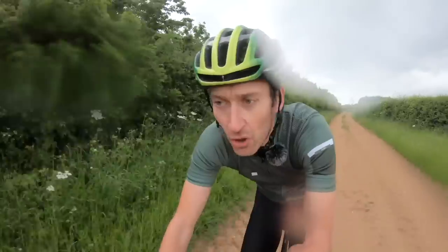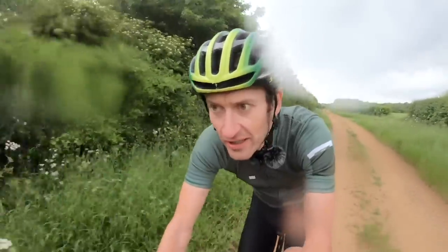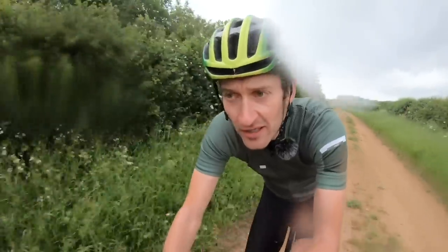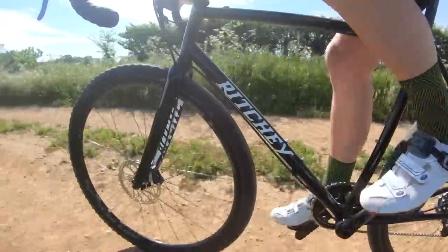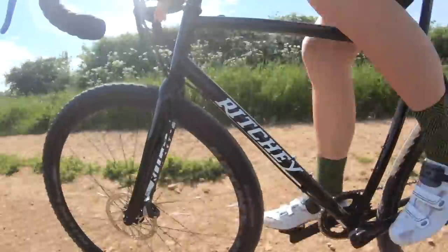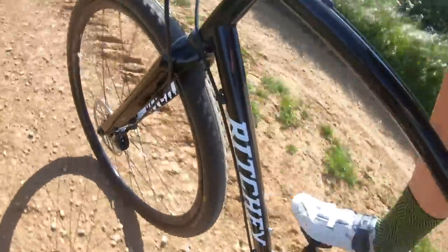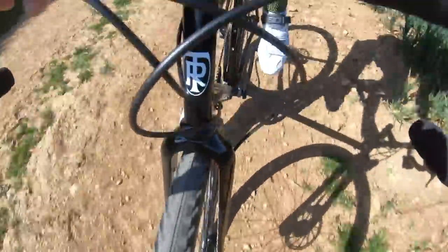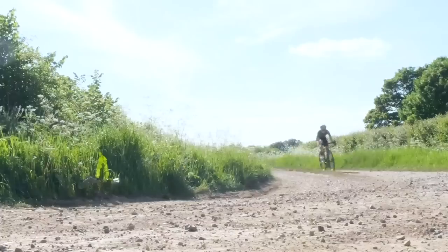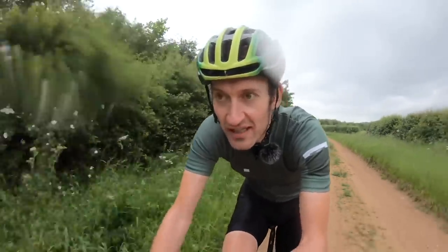It's got great speed and pretty low weight for a steel bike — the weight penalty over carbon or alloy isn't as great as you'd imagine. It picks up speed well, has a nice amount of stiffness, transfers power well, and has very direct steering despite that non-tapered steerer tube. The handling definitely errs on the side of favouring cyclocross racers — you've got that agility and nimbleness you want for weaving around a tight cyclocross course. But a few geometry changes — lower bottom bracket and stack and reach adjustments — mean that on longer distance gravel rides you've got good stability when barrelling along high-speed gravel tracks. So it's pretty versatile: CX racing on a Sunday, longer gravel adventure rides during the week.